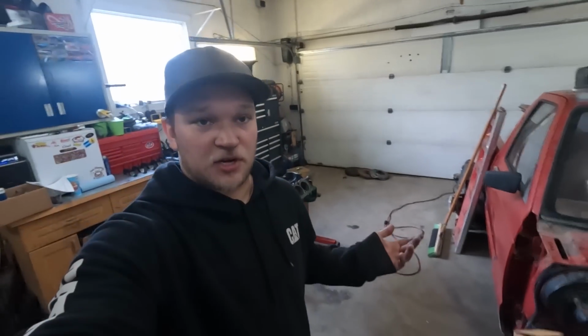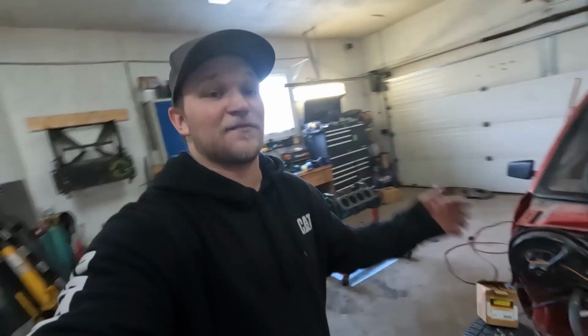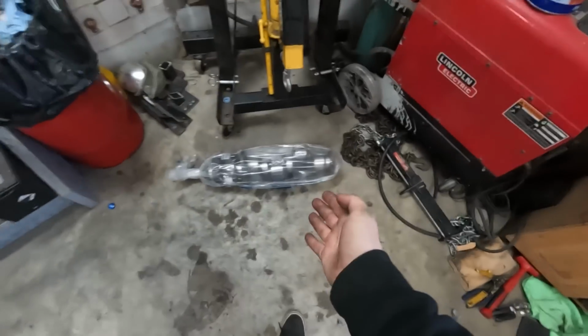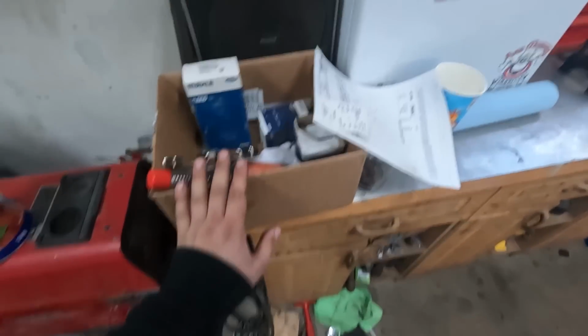I went over in the last video the carnage that happened to the poor 400 out of Farmy here, and I'm pleased to say I have some good news for you now. Since then, I have sent my crank out to the machine shop. It's completely redone and it's good to go. They ended up taking 20 thou out of my main bearings and 10 thou out of the throws, and I have new main bearings, new rod bearings, as well as new piston rings to go with it.